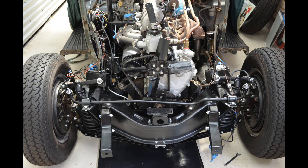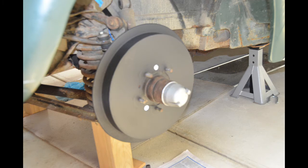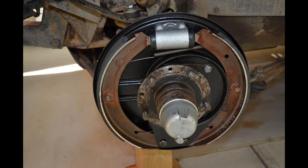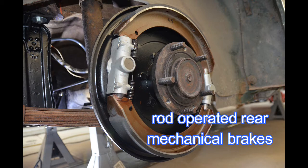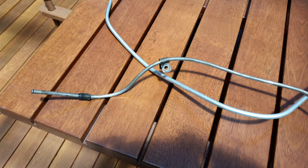There was quite a bit of work to do on the front suspension overall. I had to replace anything made out of rubber — there are quite a lot of rubber bushes in the front suspension. Next I covered some work on the brakes. Like most parts of this car I had a few surprises — when I first took the front drum off there were no brake shoes there at all, not worn out, just not there at all. Fortunately I was able to get some second-hand brake shoes from a chap in the UK. Once I had all the brake system components stripped off the car I took everything to Power Brakes at Holden Hill — they relined the brake shoes, resleeved the brake cylinders, and got the rear mechanical brakes working again. I also had Power Brakes make up some new brake lines using the original ones as a template.